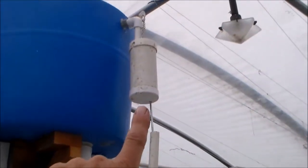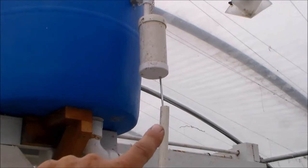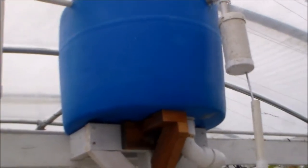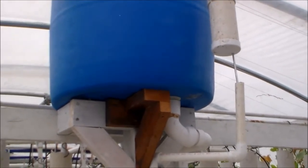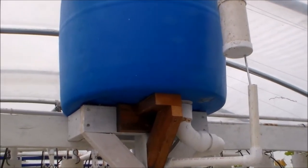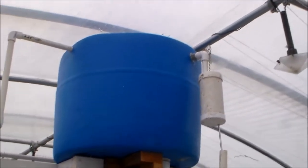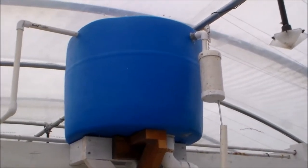The weight tank right here — that drain tube was plugged, so that wasn't functioning. When I did run its first cycle, there was a lot of debris in the bottom of the tank, and it wouldn't allow the flapper valve to close, so it would continuously drain and not fill back up. Once I cleaned it out, I used the shop vac and siphoned all the debris out of the tank, so now it's cycling like it was never interrupted.